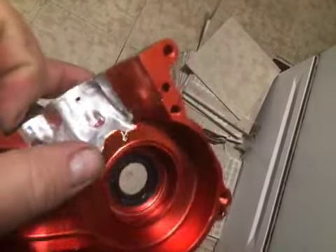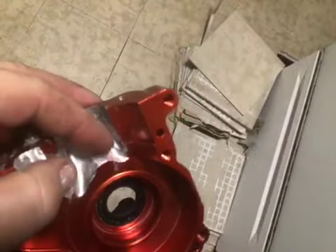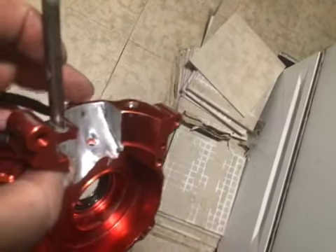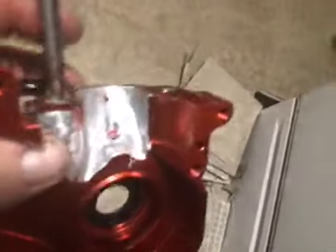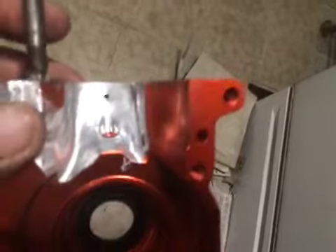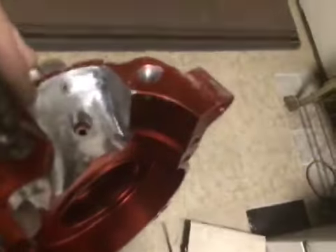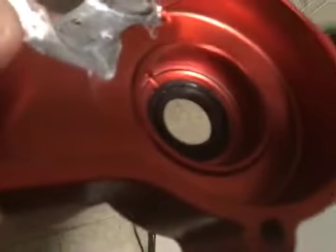You can see I've really reshaped the transfer port well. They take the pulse from the transfer port well, which is fine. I've elongated and stretched the hole for the lube mod to the main bearing, which comes stock in this — it's already lube modded.